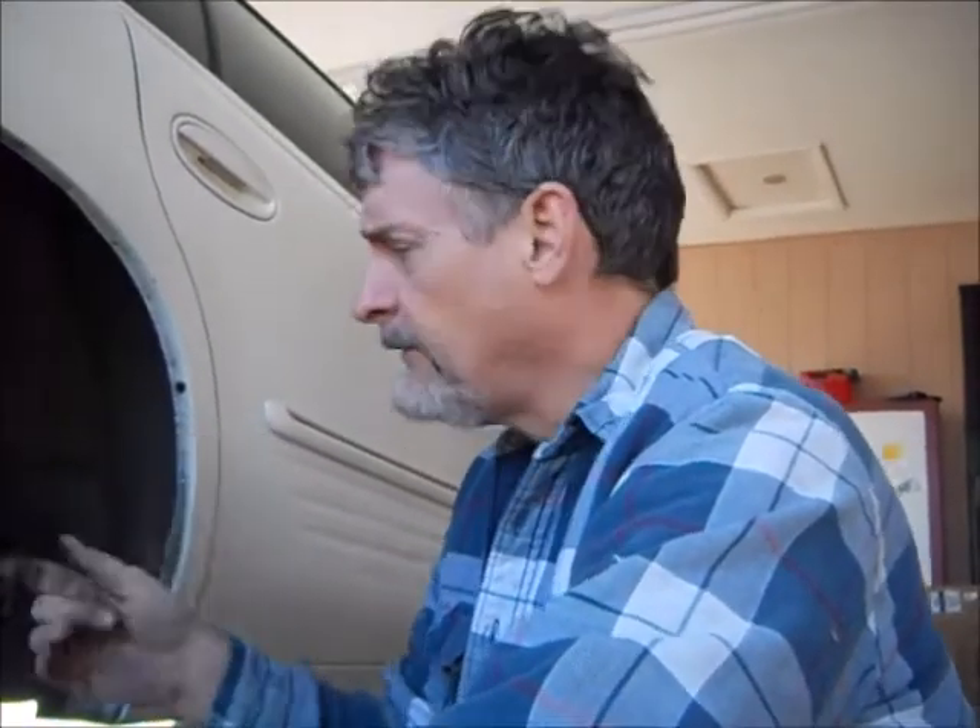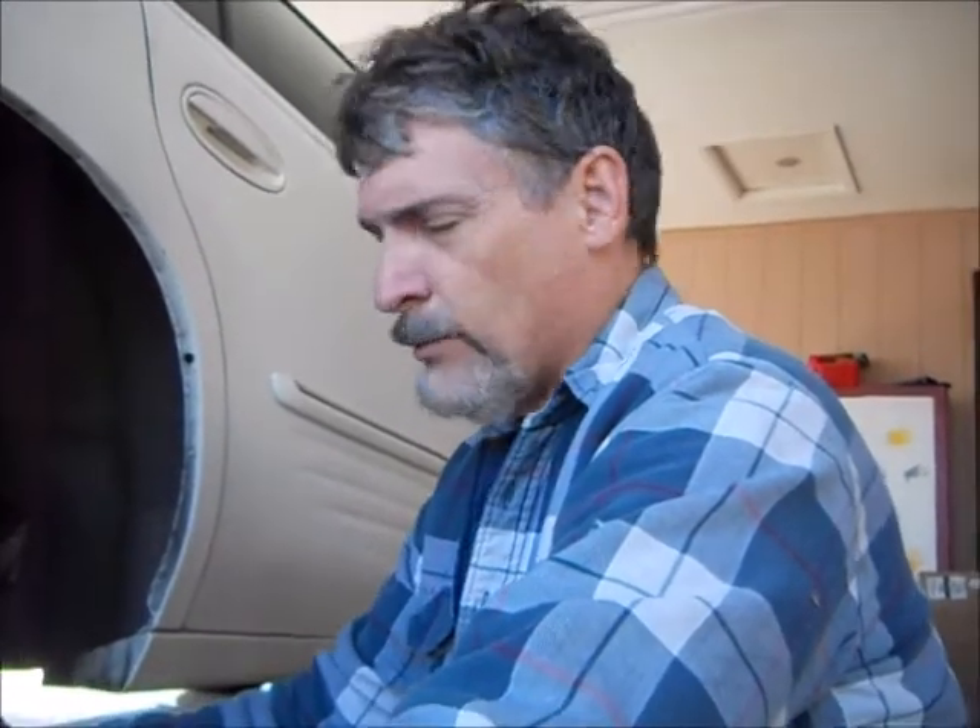Got the back of the car jacked up. I checked the driver's side — this is the passenger side — and again I see absolutely no leakage of brake fluid, and the brake fluid reservoir is still pretty full. The sponginess on the brakes I believe is contributing to the rear disc brake pads being close to needing replacement. The other side's sensor looks pretty close to catching, and that's probably what I was hearing — a groaning sound when backing up with the brakes applied. A bit of an odd sound, but this is a different car I haven't driven before.